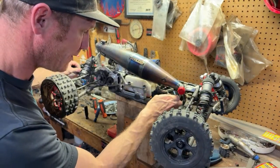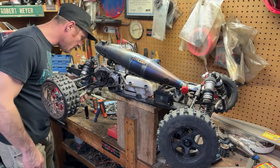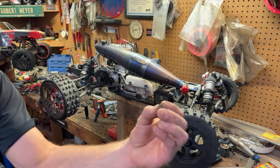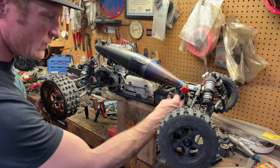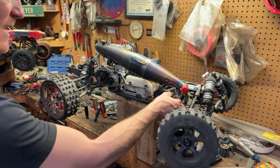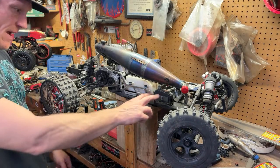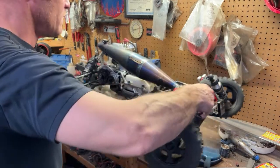Oh Lord, look at that. I'm gonna have to do something different with that. These servo grommet things. I'll see if I got one. I should have one somewhere. Yeah, these are different, but this is kind of what it is, if you can see that here. It's just a little grommet. But this one, well, look. It pulled. I had to tighten them tight enough to where it just kind of pulled through. I'm gonna have to come up with something different there. Hopefully, the AGF RC servo comes with better stands or something. I could probably actually put that in solid mount. To be honest with you, there's no reason why it can't be solid mount. Same thing with my steering servo.